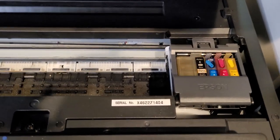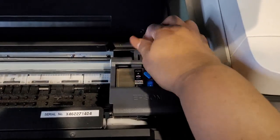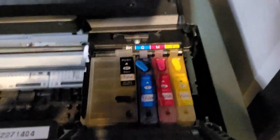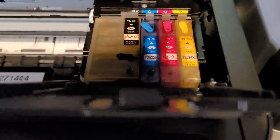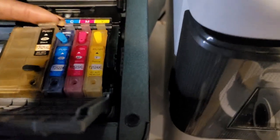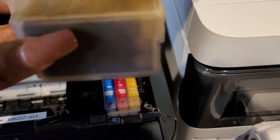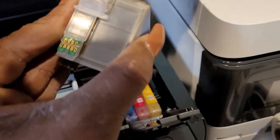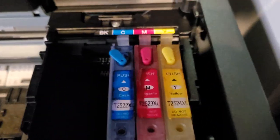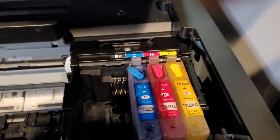All right, so this is inside my printer, and I'm working with one hand here. So I would just take and lift up the back, and those are the cartridges, remember, that I showed you earlier. And you would just take and pull the back like that to pop them out. Okay, so this is my black, and remember, you don't touch that metal side, but that metal side is what's going to be lined up with the metal inside. You see the metal piece back there. I'm going to line my black up with that metal piece,